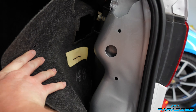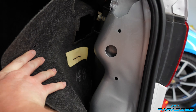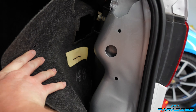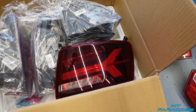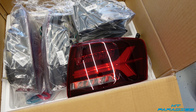Now I'm going to show you how to remove the carpet version rather than just taking off the little tab, so that when you replace the new lights you can have all the plugs inside. There's this handy interior removal pry tool — a bunch of these on Amazon are super cheap for removing all kinds of panels. I'm going to put it between these two plastic pieces and pop right in there, then pull straight up and out. Once that tab is removed, grab the entire carpet and use the same tool to push it out, pull it completely back, and you can even go ahead and unplug it and unscrew it from here.